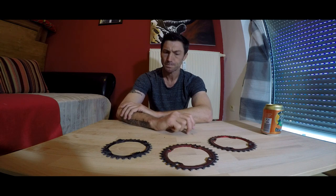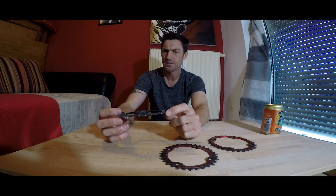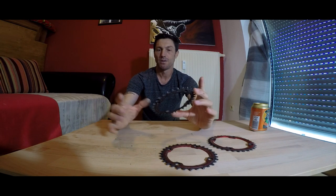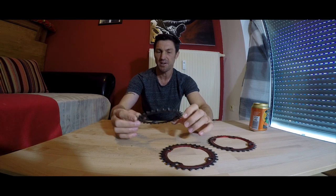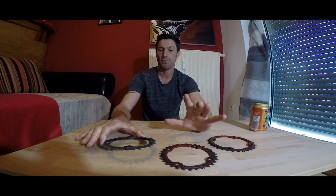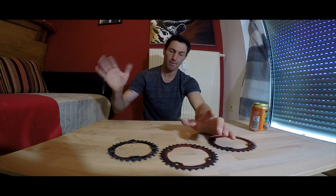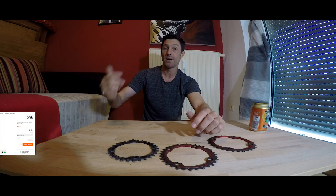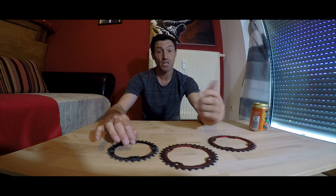I like that a lot. Unfortunately I haven't been able to find it at a good price again — it just became difficult to source affordably. Of course, you don't need to run a chain guide when running a narrow-wide; it's not 100% necessary, though it is a lot safer and you naturally drop a lot less chain. You can run one of the larger full chain guides or, like on my enduro, just a small light chain catcher which is much cheaper to purchase.